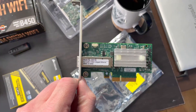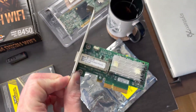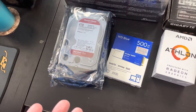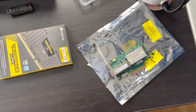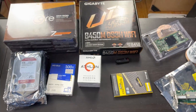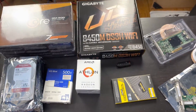This second card is a Mellanox ConnectX-3 — basically a SFP+ 10 gigabit networking card, just so I can get faster networking. Now I know since I'm using hard drives the speeds won't be anywhere near 10 gigabit, but having this gives me future-proofing if I add more drives or get a FreeNAS build with better performance. Overall, for all these parts the pattern is really just whatever I could find that was good enough and on sale for a good deal.